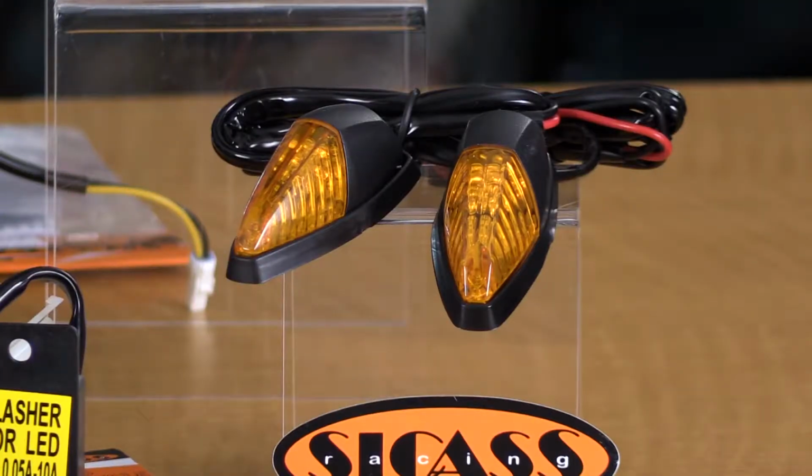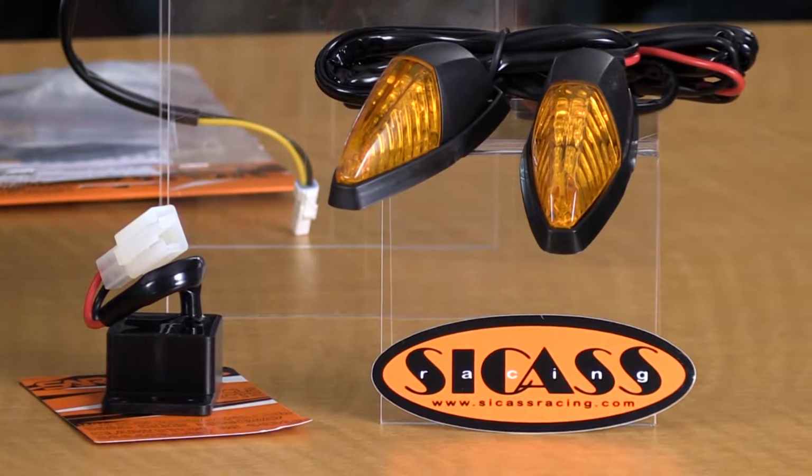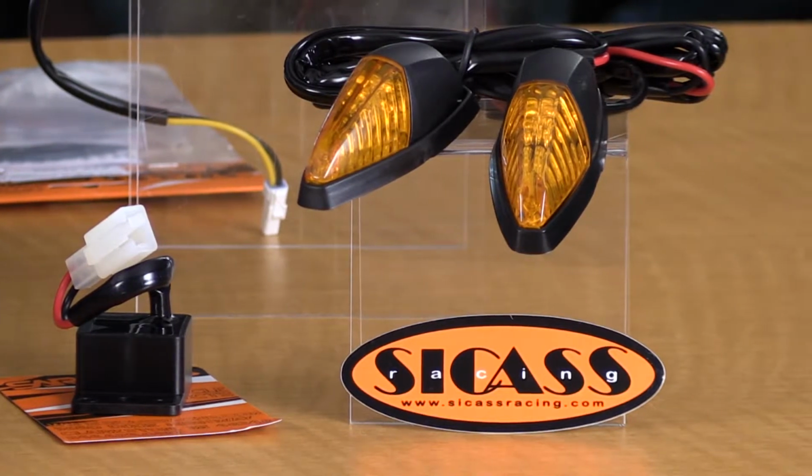If you notice a lot of these bikes riding down the road, the turn signals are falling off and the license plate has been mauled by the rear tire. This keeps that from happening. Now, if you notice here on the table, I chose LED options as far as the turn signals go. The reason that I've done that is incandescent bulbs typically fail a lot sooner and more easily than LEDs. If a single LED bulb goes out, you still have plenty on that side in order to get you home until you can make the fix or the replacement.